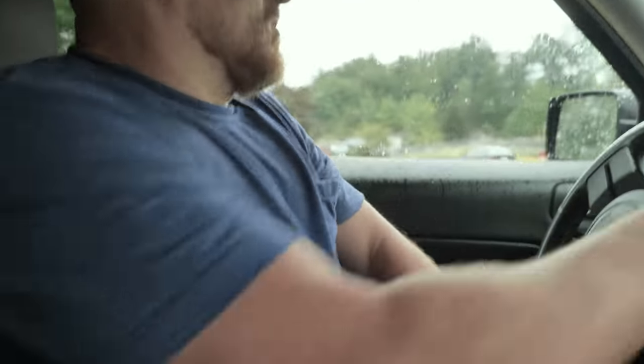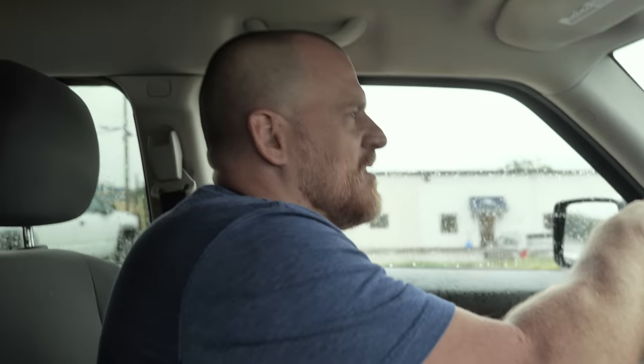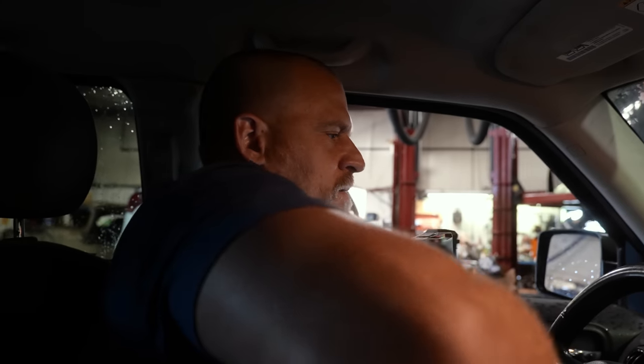This is why you test drive a car right here. Listen to that growl. I can barely turn the wheel at low RPM - it's better when I raise the RPM. There are things knocking and clanging, wheel bearings growling, and power steering doesn't work right. It's okay at higher speeds. I think that's a wheel bearing. Severe misfire at low speed. This thing is a turd on many fronts - zero pulse width on cylinder two and the lights are flickering in conjunction with the misfire. This came from another garage.